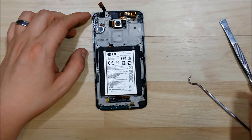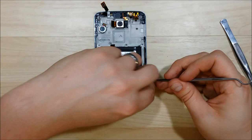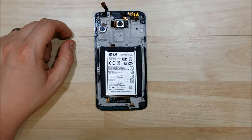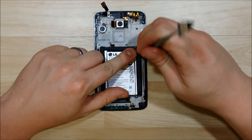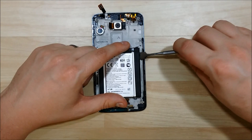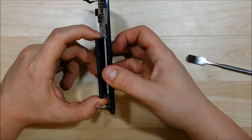There is a board down here at the bottom held in with a screw. I'm just going to remove this tape here to get it out of the way. Next we'll do the battery — make sure you use a nice flat spudger; I like one that has a little bit of a curve. This battery can be difficult — it will flex and bend a little when you take it out. It's a polymer battery, so it will give, but you do not want to pierce it. I put my spudger in and wiggle it back and forth to free one side of the battery, then slide the tool underneath and give it a nice medium force, pulling it forward and sliding across to cut any additional glue underneath. Then we can pull the battery free.